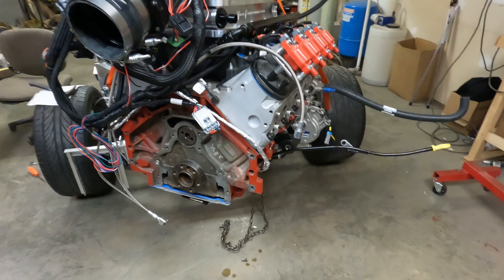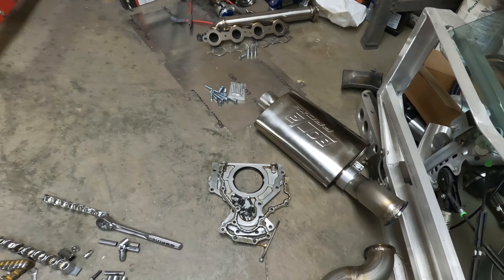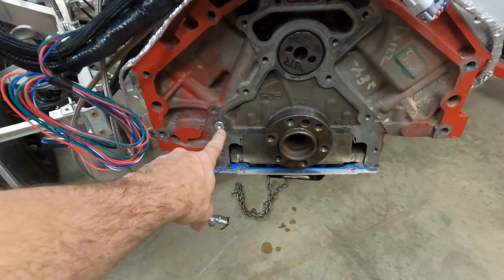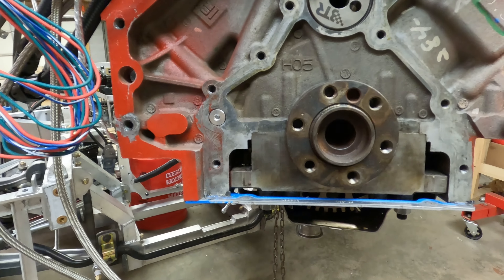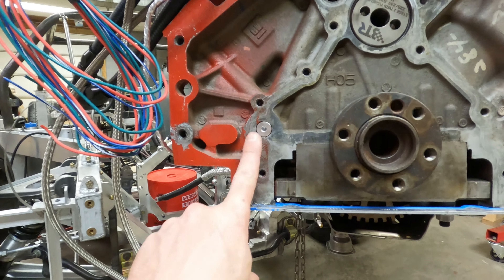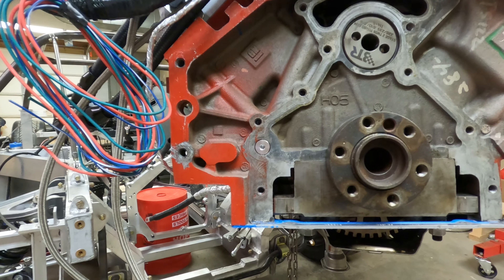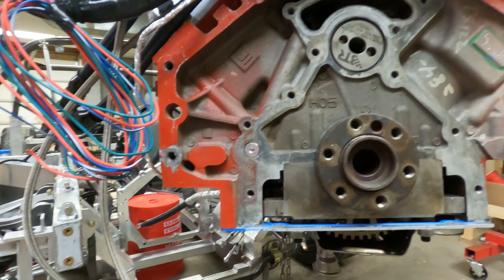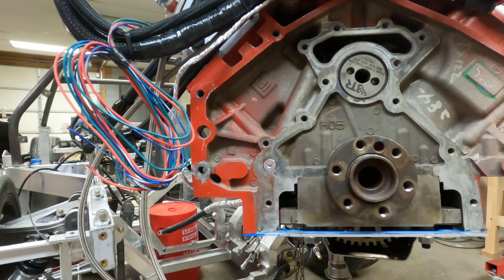Here's the engine. I have it torn apart as far as I'm going to take it. I removed the back cover with the rear main seal on it. I took this off because I originally did not replace this — it's an oil passage they call a barbell. It directs the oil flow from the oil pump to the correct journals in the engine. The old one is plastic, and the engine had well over 100,000 miles on it, so it was old and brittle. If they break, they can cause a lot of issues — the engine won't oil correctly and it could ruin the engine.